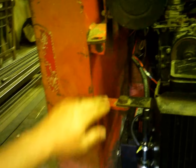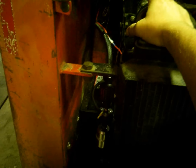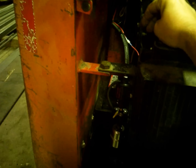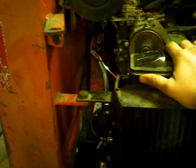They will catch prime also. The reason I really wanted an electric pump is, if the fuel level's low in the tank and the carburetor's up higher, it could leak back out. The carburetor's got a fuel shut-off, but they used to say that is not a perfect seal, and it could run back out. With these electric ones, I can turn the key on, let it sit for a second, catch prime and fill the carburetor, then go ahead and start it up — a lot less cranking that way.